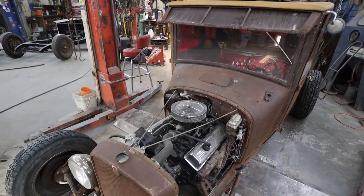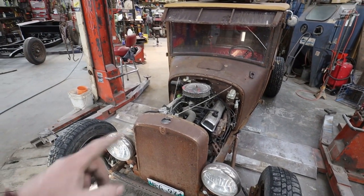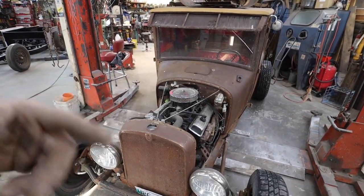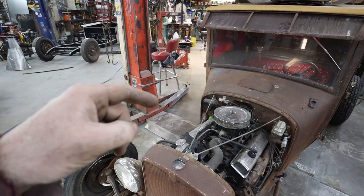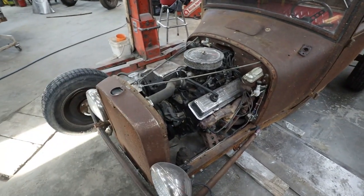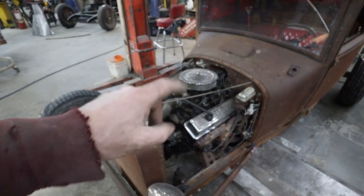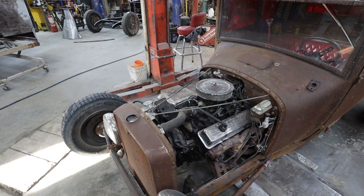Transmission's good. I'm just going to take the stall, keep that, and we'll just freshen it up with a much milder motor. The problem I kept having was a lot of vapor lock issues, boiling up the gas and stuff. I was going to put a regulator on and run a return line. I think it's because it's such a closed hood. But it's only since I've had these really aggressive motors in here that that problem came.